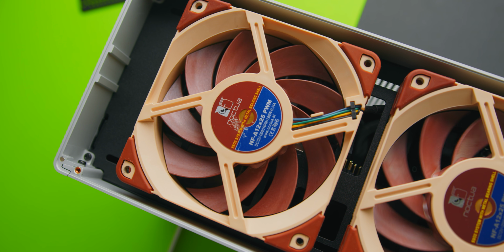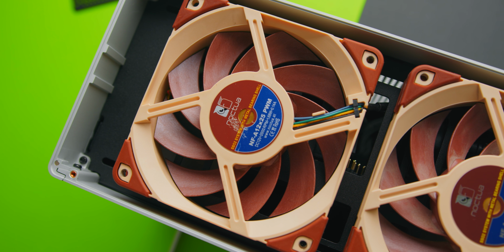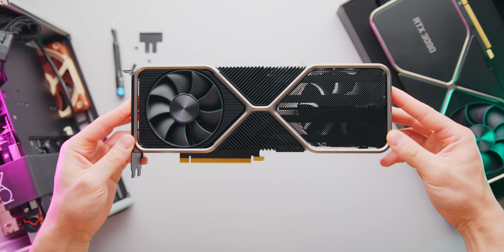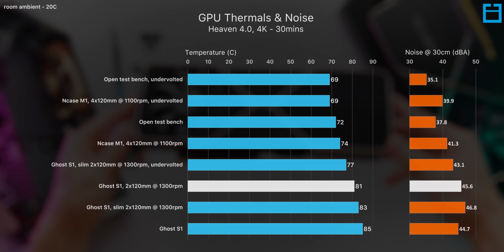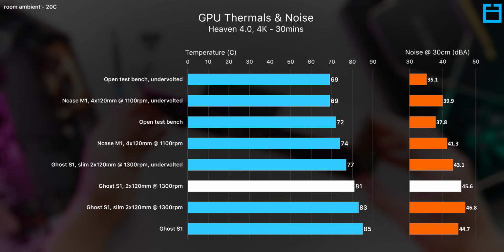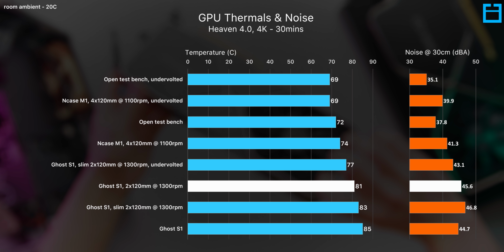But with a pair of full-sized 120mm fans instead, we can potentially move more air through the case with the medium top hat and reduce thermals a bit more. Here the improvement wasn't as much as I expected, and this represents kind of the limit of how much you can improve thermals for this setup with a single pair of fans.